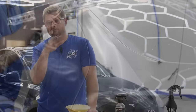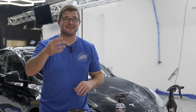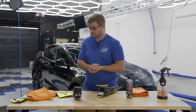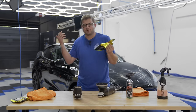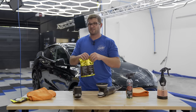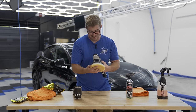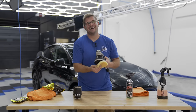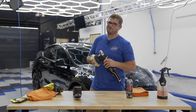The driver's side is done and completed. Let's jump to another pad — this one is feeling pretty toasty. With a one-step you're typically working at a higher speed. You can work slower if you're not on a time crunch, but time is money. Moving on to the secondary pad. Since the roof is glass, I'm just going to spray Beadmaker on the glass. Typically me and Levi can get through a whole car with about two larger pads and one smaller pad.